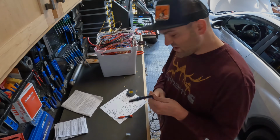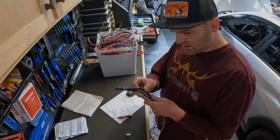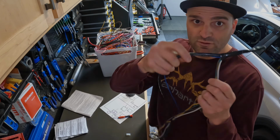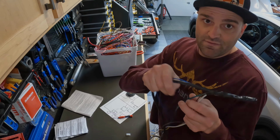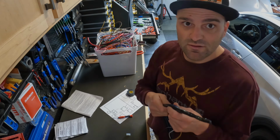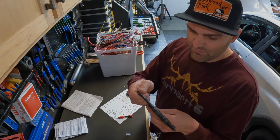There's a couple wires that I'm putting through intentionally. One obviously being the switch controller wire. Then I have a wire for the footwell illumination I'm gonna do and wire through the Switch Pro. And then there's also an ignition wire that I'm gonna run to and add a fuse I already have in the cab fuse panel for a Valentine one. So I'm just gonna tap into that.